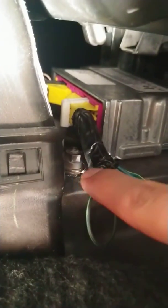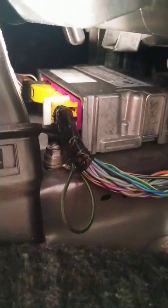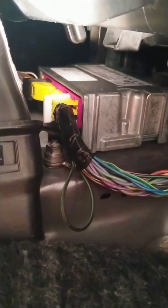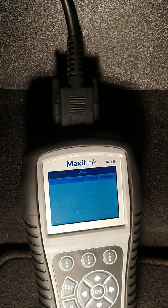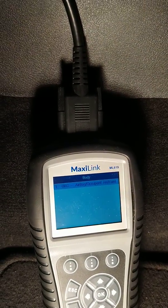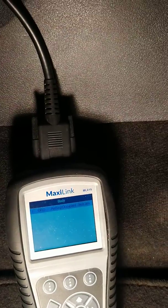As you can see, the ORC is this box right here, and my problem was the bolt. This bolt and this cable was not making a good ground, so for that reason it wasn't getting any power and it was not communicating to the OBD2 reader, which is this one right here. If you come across this situation, just make sure that the ORC is making a good ground.